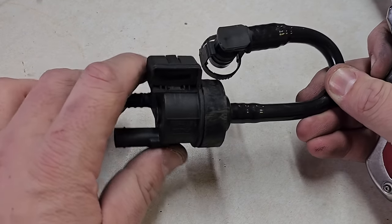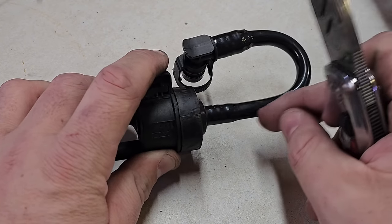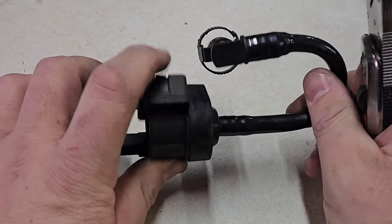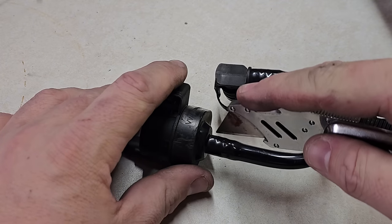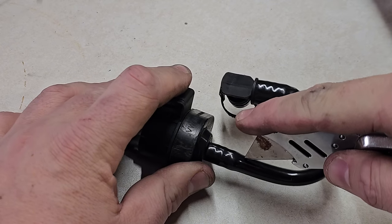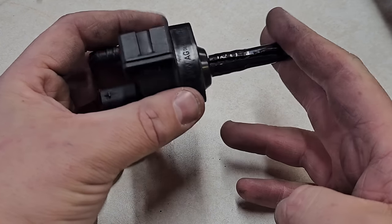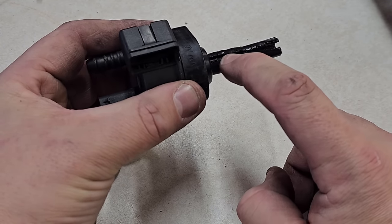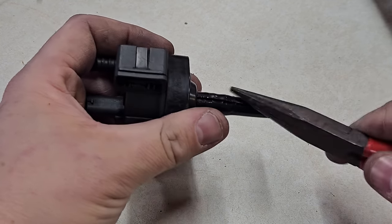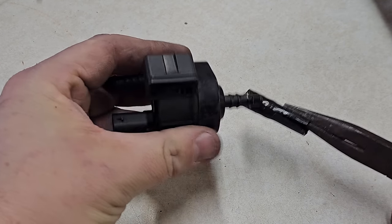To relocate to the MRA 1900, we need to remove the actual OEM line. Since none of us are planning on putting the OEM stuff back on, we'll just cut it — they're cheap enough to replace if you ever decide to reverse things. Put a relief cut over the barbs because it's on there tight. Take a razor blade, cut a line down the center, then use a pair of pliers to work it apart, and it pulls right off.